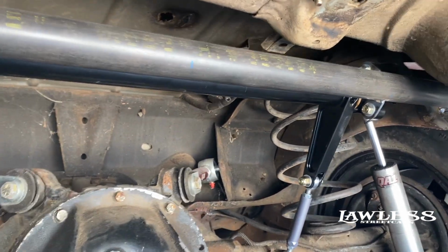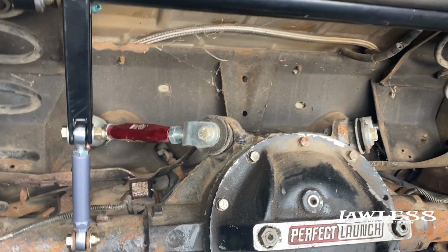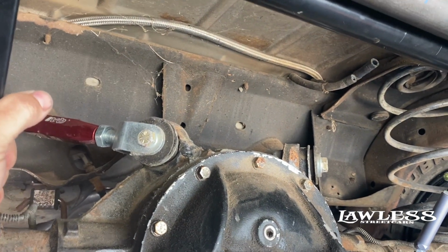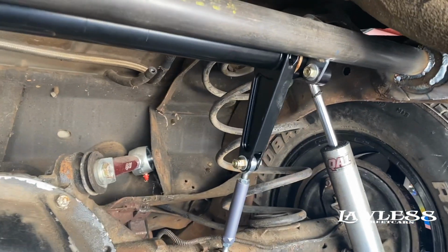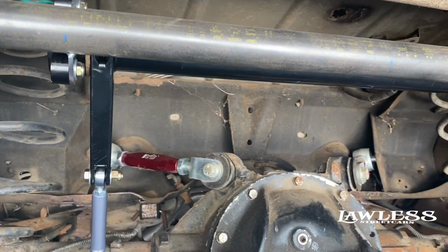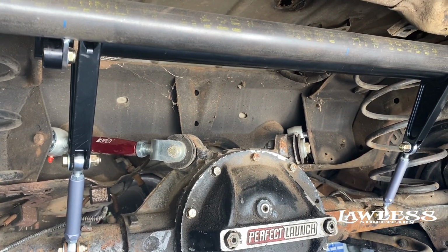And also, if you got a car that's driving toward the center line, or a car that's driving toward the outside, you can adjust a lot of that out with this. It's just a helpful tool. Every car, minimum, if you're running an 850 car, you really need to put an antiroll bar on it, because it does help with the tuning of the car. That's pretty much the install on a G-body. It's not too bad of a job, but hopefully that helps y'all if you're trying to do it yourself, gives you some ideas on how to do it.